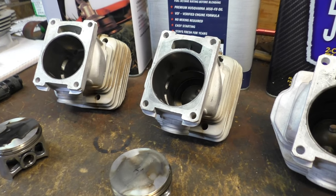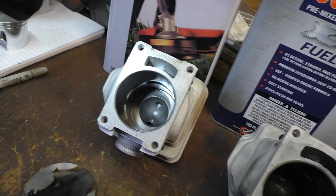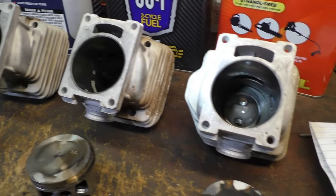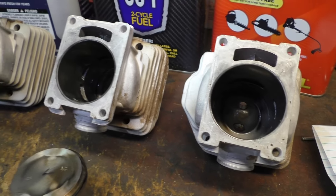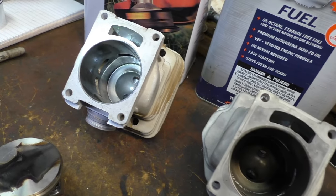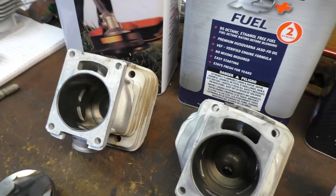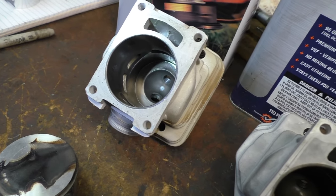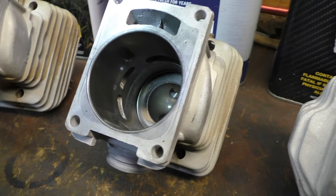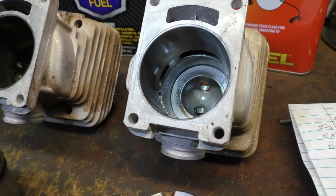Yeah, but it shocks me because all of the years that I've dealt with working on saws and modifying saws and fixing saws of all kinds of brands, the Stihl white bottle or whatever you want to call it, synthetic oil, silver, ultra, whatever, has shown to be some of the worst looking oil as far as carbon goes. So maybe it doesn't interact well with the impurities in the gas. It has to be something to do with the gas itself, where pump gas has a lot of other additives in it, where the oil is not working so well with pump gas, but it works well with this high-grade gas. That's what I see going on here.